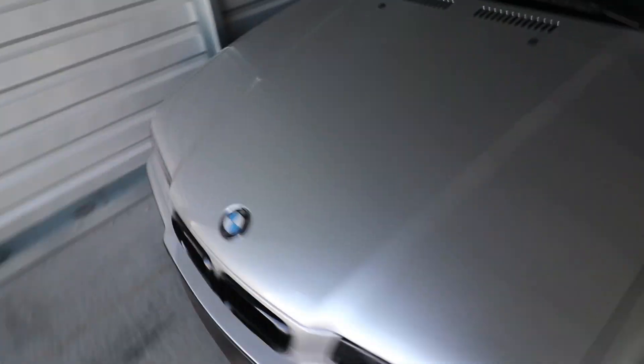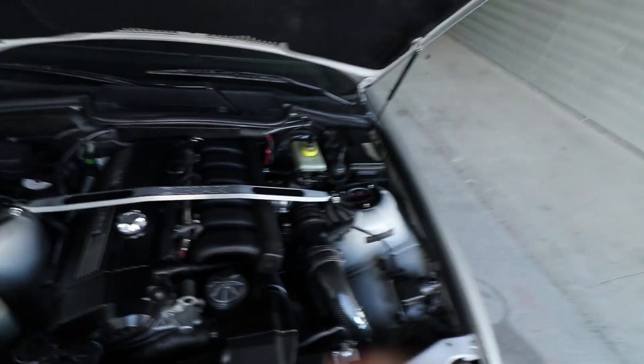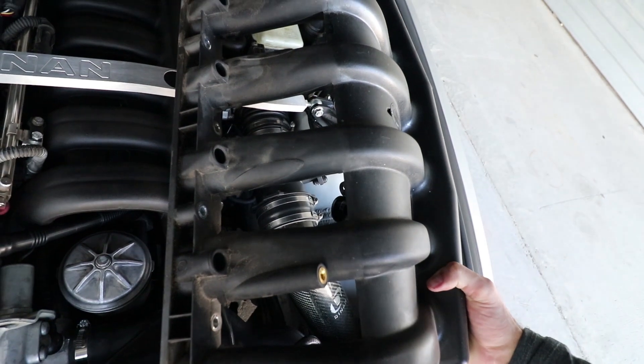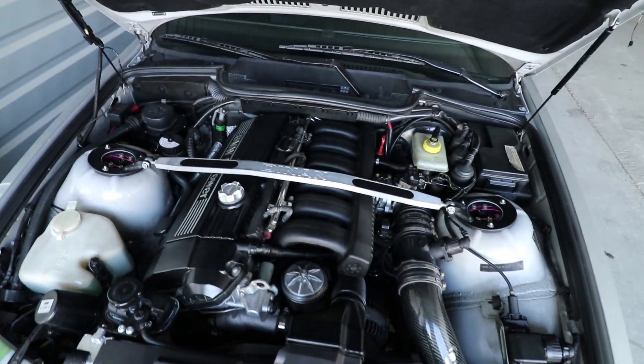So if you guys saw the last episode, at the very beginning I talked about this M50 manifold that I just had put on the car. I mentioned that I had emailed RKTunes for a revision for the new tune for having the M50 manifold, because right now the tune that's on the car was for the stock manifold. And here's what this thing looks like — you don't really need a tune for the M50 manifold, but the runners on the M50 manifold are so much bigger than the ones that come on the S52s and M52s. So getting a tune for that is going to make a big difference and give me some more power. Hopefully in the next episode I'll have the tune by then and we can get it put on the car, so I can tell you guys if a tune really does make that big of a difference, if it's really worth getting, or if you should just throw the manifold on and leave it at that and save the money on the tune.